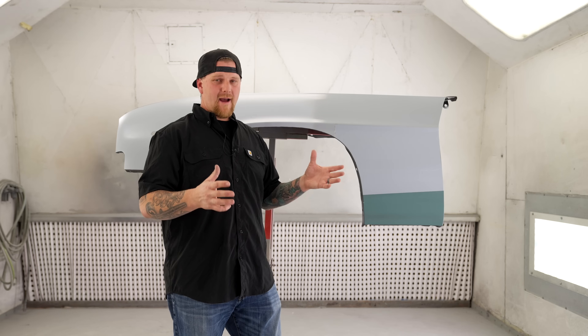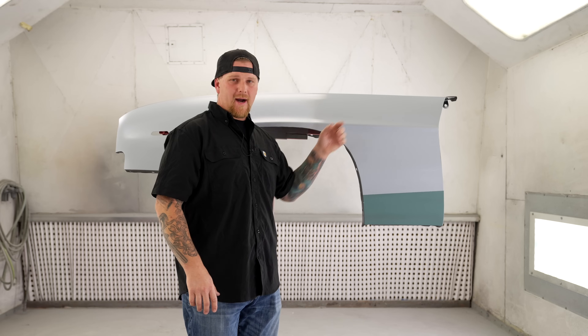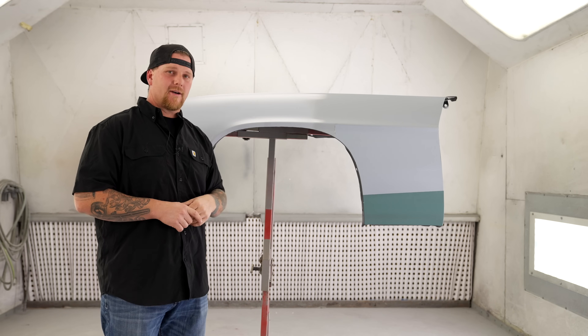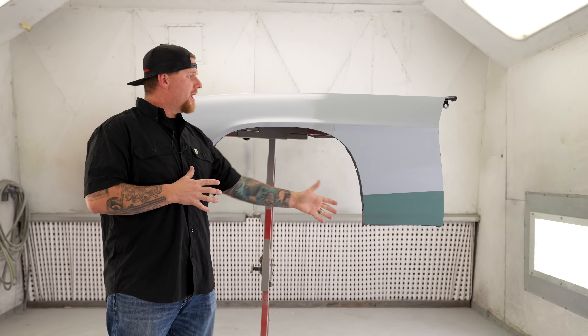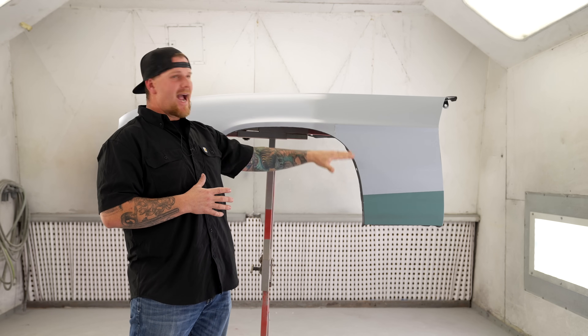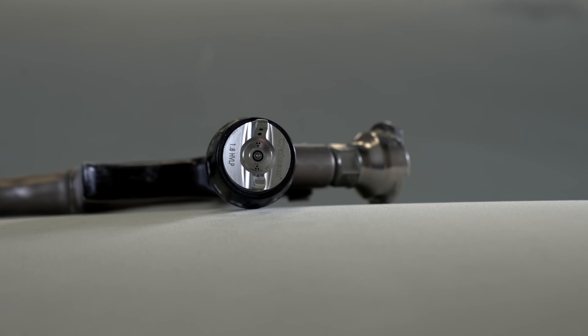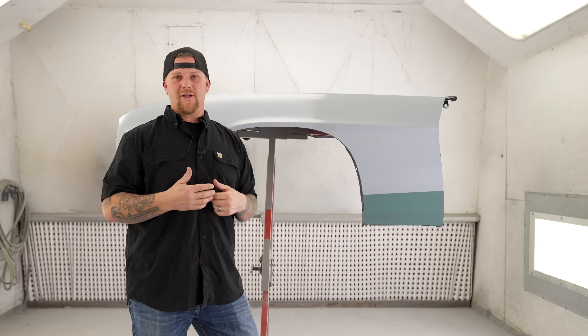Just know the main primers: urethane comes in thicker for high build or thinner for a sealer; epoxy is either not sandable or sandable as a high build like VP-2050; and polyester is either DTM or not. Understanding where and when to apply these primers — none of them are technically wrong, you just have to know what they're used for, and you can stack them as long as you're following a technical data sheet. I used a Walcom 1.8 tip for every one of these products — just adjust your needle and fan to achieve the finish you want. Now that everything is sealed up and ready for paint, if you want to know how to do a mirror finish, we've got a video for you — link in the description.